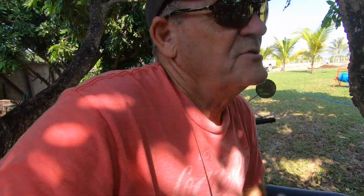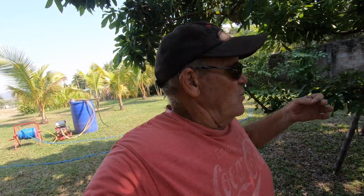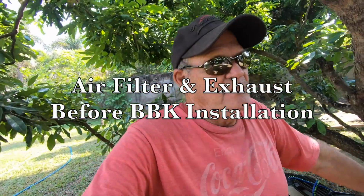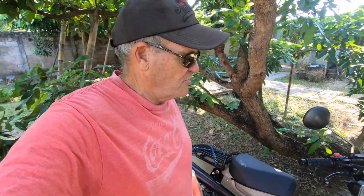At the same time I was doing the air filter system, I also went ahead and put the exhaust system on. I had a subscriber that wanted to know what I gained or didn't gain when I put the air system and the exhaust system on it. To be honest with you, I didn't notice much difference from stock. I'm sure that has to do with the ECU and fuel injector. If the ECU is not going to give you more fuel, then it doesn't do any good to put an exhaust system on there with an air filter.